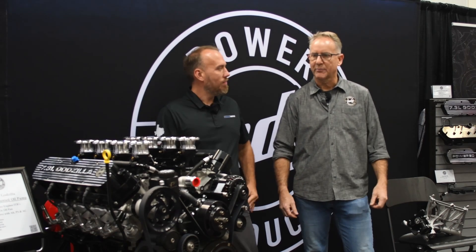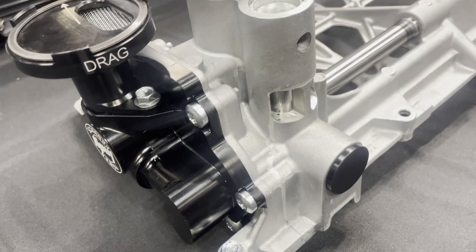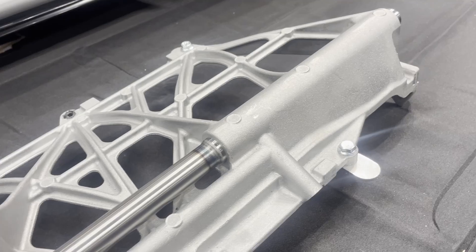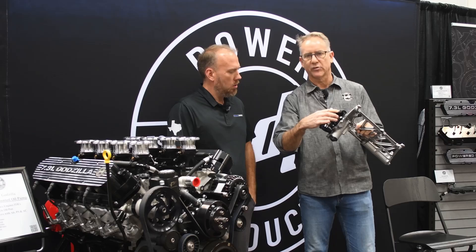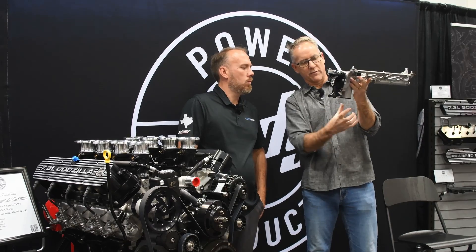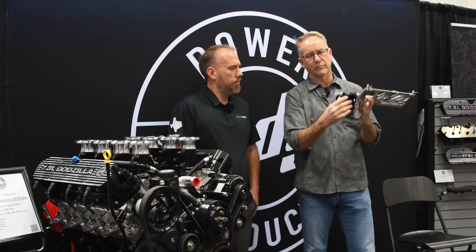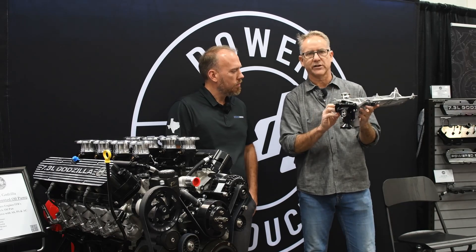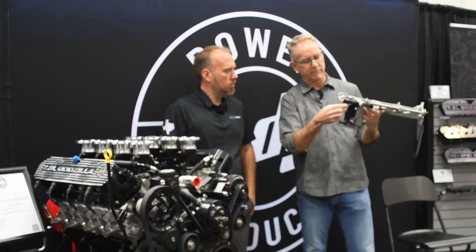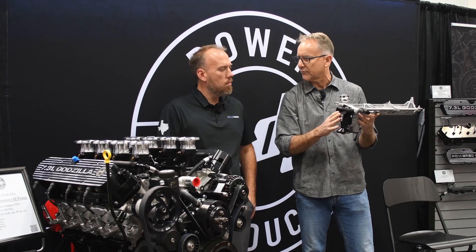James, we have a new upgrade kit for the stock Ford oil pump. If you're putting the 7.3 in something, you want to shorten that oil pan by 6 inches and keep the Ford factory oil pump. We have this kit here that bolts to the back of the factory oil pump. What that does is take the Ford factory pickup, shorten it up 2 inches, and it also includes the pressure relief valve so you can eliminate the computer-controlled variable oil pressure control. The pressure relief valve will take the excess oil pressure and dump it back to the inlet side of the pump.